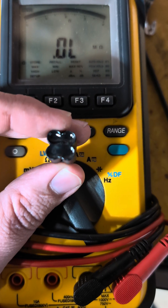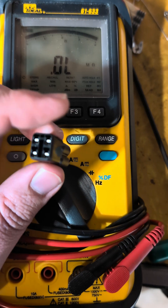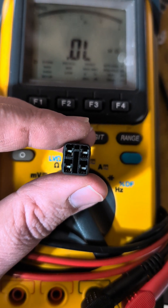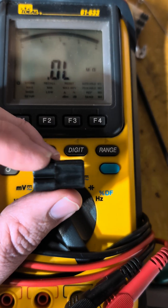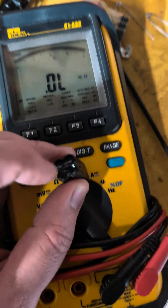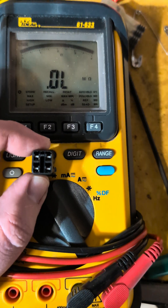I'm pretty sure I can make that myself. This connector is called a Sumitomo — I would bet it's an HM-90 series sealed connector. There are a lot of websites where you can find motorcycle connectors. Just get a good look at the front and the side and go look around. The weatherproof ones have a little rubber cork that follows the wires into the back to keep the weather out. I'll bet you could get one of these for probably three bucks if you're just buying one.